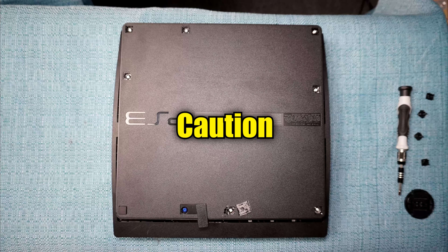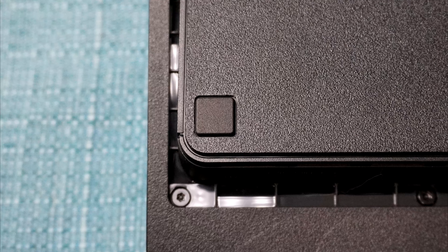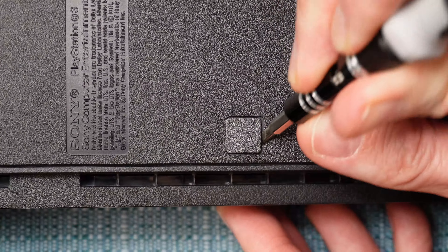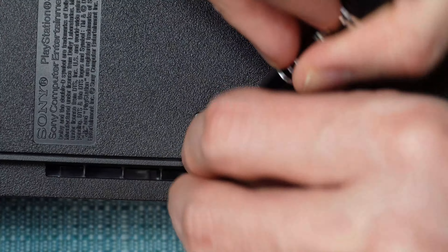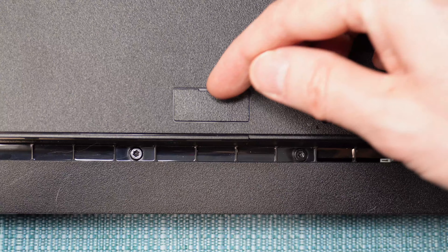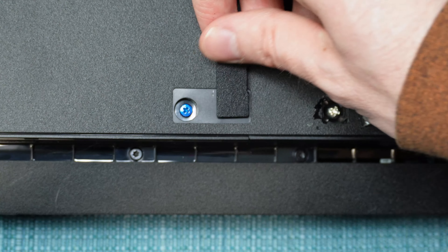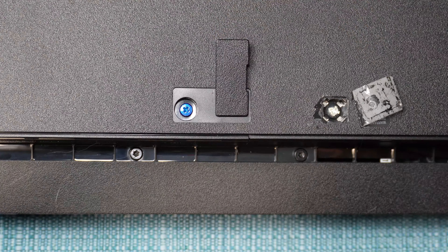Place the system face down on a soft surface and remove all the screws indicated on the screen. Some are under the pads — only three of the four pads — and some are under these little plastic doors. You just have to pry them open with a tiny flathead screwdriver. One of those doors is under the warranty tape, so bear that in mind. One screw is under a larger door — don't pry that door off. You just lift it up and turn it like so. Once the screw is out, close the door back so it doesn't get snagged on something.